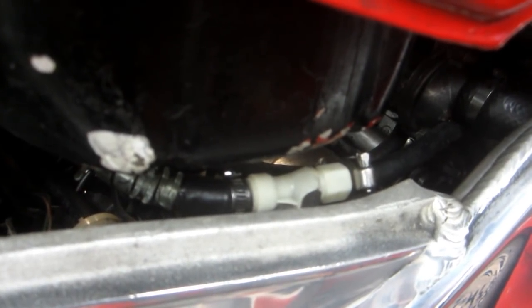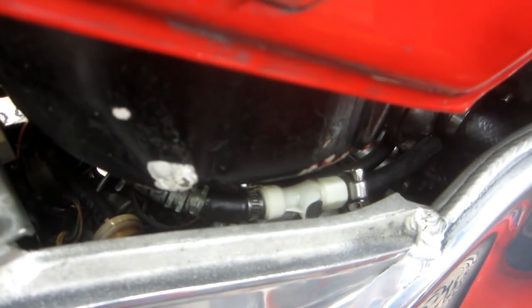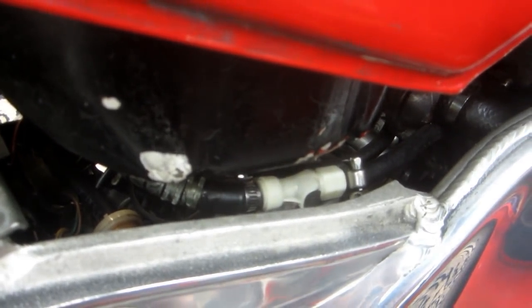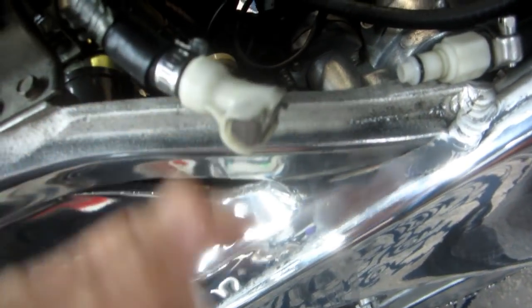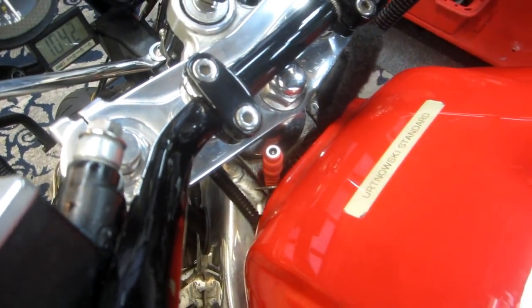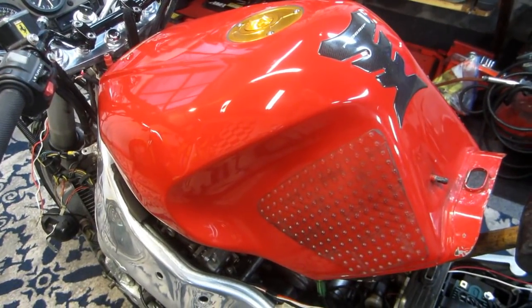If you don't have a quick disconnect fuel line, this can be a messy job. This was really one of the best investments — I have these on all the bikes, so I can pull a tank without making a mess and getting fuel all over the shop. Every time I use this I just think what a great investment. The wiring that goes to the sending unit has to come off, and then the last little thing on this bike is a cotter pin up in the front — the pin comes off. It's really a well-engineered thing.